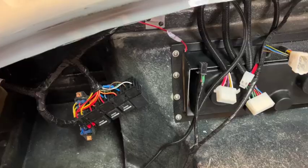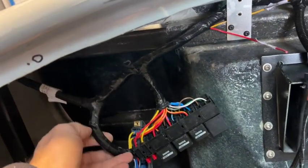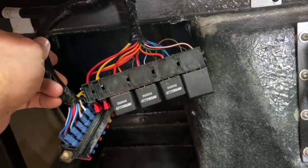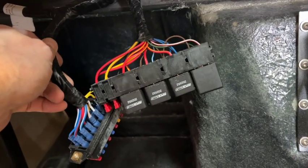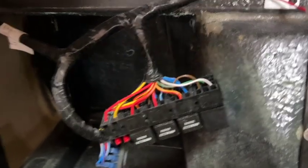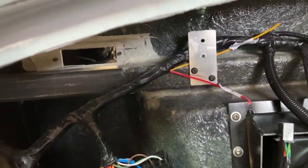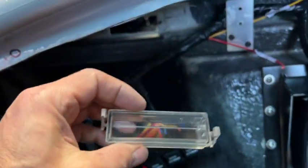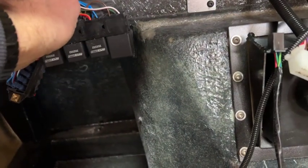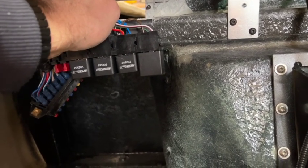First decision made: on my previous car I had the fuse box section facing into the engine bay, which was really handy and looked quite professional. It saves having so much bulk underneath and saves fanning around under the dashboard. Because you've also got two blocks of relays to fit in there, it is a bit tight. So I've made a hole up here and I'm just going to poke the fuse box section through — it's got a plastic cover on the front, so that'll mount nicely.